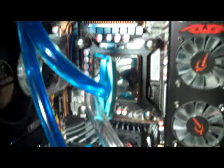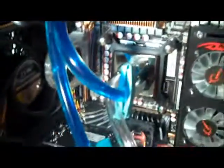But I would like to give the graphics card priority, since my goal here isn't to push the overclock on the CPU as far as possible. I'd like to give the graphics card the most stability and capability if possible. Alright, let's go ahead and pull the clips off. Everything's solid. Heatsink's got new thermal compound all tightened down. Now I just need to remove the hooks, but before I do that, I'm going to add my fluid back to my reservoir just because I don't want to introduce any unnecessary bubbles to the system, even though I realize it does need to purge again.